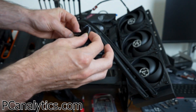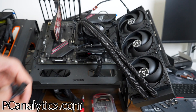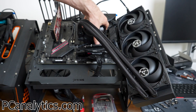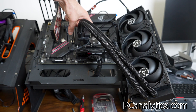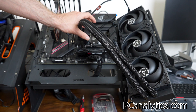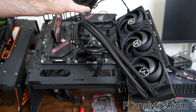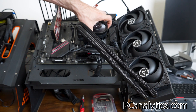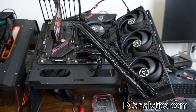It's better to install this cable prior to installing the AIO pump or putting any thermal paste on. So once you've decided which cable you want to use and it's installed onto the AIO pump, you then want to install the AIO pump. Make sure you put the thermal paste down before you do it — I like to put it on the CPU. Once the thermal paste and brackets are installed, secure the pump onto the brackets. You can then slide the VRM head on top, held together by magnets — no more screws — and you're ready to start it up.